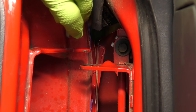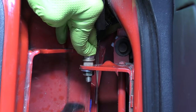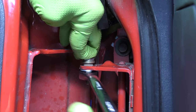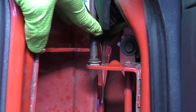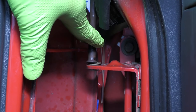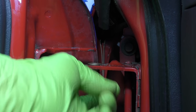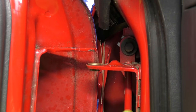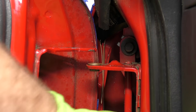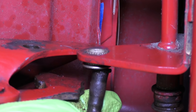For the upper mount, the top one is going to be the smaller bushing and the bottom is going to be the bigger one. Our top one on the door is the smaller one. We'll get our little press rig and drop it in place. From there, you can take your old pin, set it right on top — it's got a nice flat edge — and just tap it down the rest of the way. These should go in pretty easily; you shouldn't need the biggest hammer you have. Just some gentle taps ought to do it. Make sure you don't hit it so hard that you're bending the brackets on the door or on the body of the truck. Same thing for the lower bushing — this is going to be our bigger one going from the bottom up.